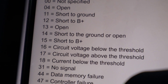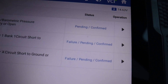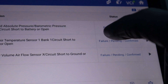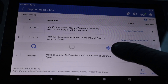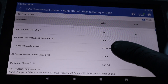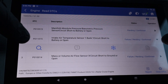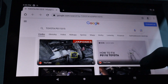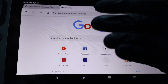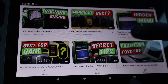That is because I left the connector unplugged. For each code it will tell you what type it is — either pending, confirmed, or permanent. This failure should be a permanent fault because I left the connector unplugged. If you open the code, there is additional information: first the freeze frame data — live data parameters from exactly the time when this code was stored in the ECU. You can also tap the search button and it will show you YouTube videos, blog posts, everything you can use to fix this code. The scan tool also works like a regular tablet — you can even go to YouTube.